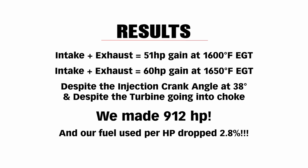The precision turbo is a magnificent piece, but every turbocharger has its match. We've pushed the turbo beyond its match point. So I called up Dan at Precision. We talked about it. I told him what I was looking for. He's building a turbocharger. I told him, use your judgment as well as mine. We're partnered up on this. So there'll be one coming very soon. And we're going to have a variety of turbine housings to be able to tune the shaft speed versus mass flow, AR ratio changes.